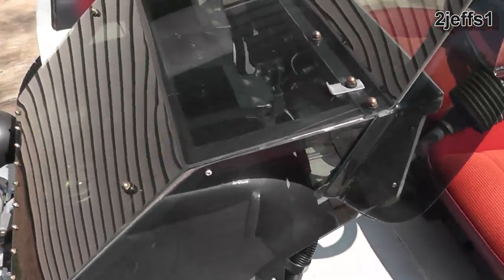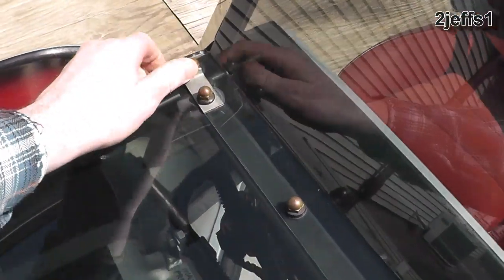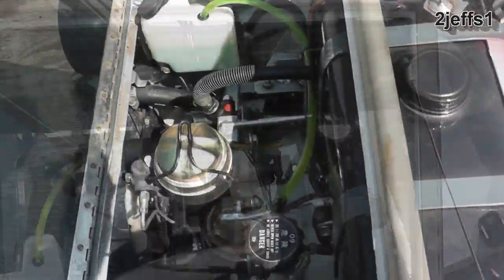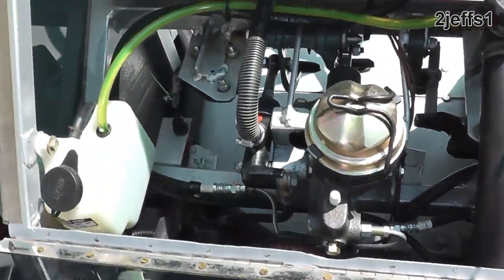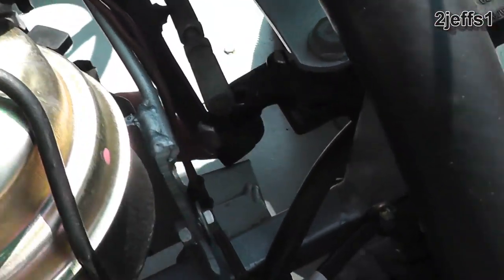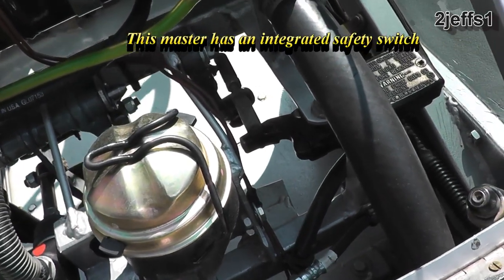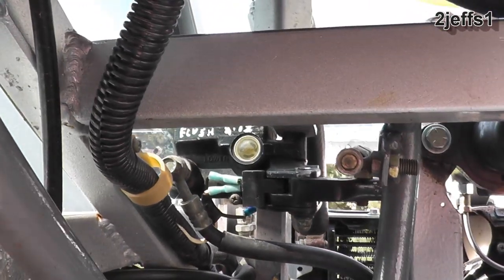Let's start with the hydraulic clutch setup. I utilize the hydraulic master cylinder off the motorcycle handlebars. There's a cap where you fill the reservoir. There's a turnbuckle adjustment for fine tuning. You can see where I cut that handlebar off, then added a rubber pedal stop as the final touch — you can see the two layers there.